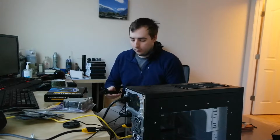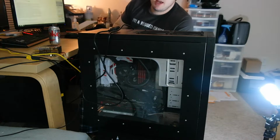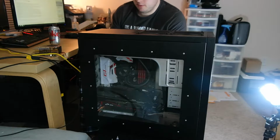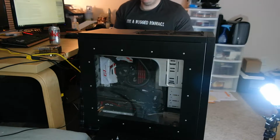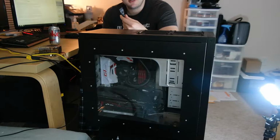Well, I had a bit of a difficulty here, so it's later in the day. I was mentioning I use this adapter that has a single Molex power plug, which allows me to plug things in separately from the power supply on my PC. Earlier today, however, I found out using a multimeter that one of the ground connections on this Molex plug is bad. It's not grounding correctly. Molex power plugs have a 5-volt connection on one side, a 12-volt connection on the other, and the two middle are actually grounds. And the ground on the side of the 12-volt wasn't working.